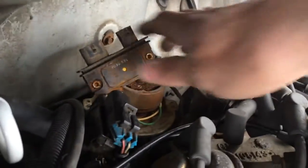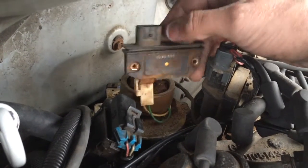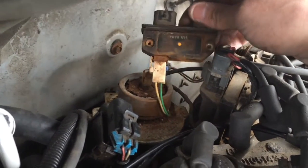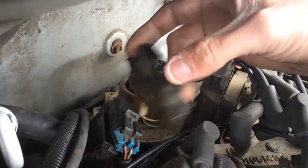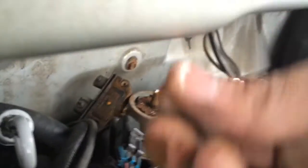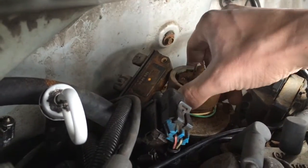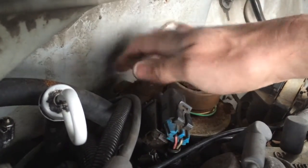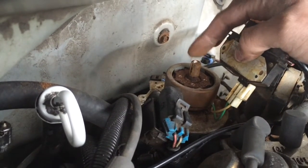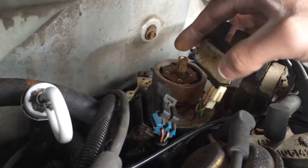There's a pigtail here, but there's a lot of corrosion in this distributor, which is starting to make me think the distributor itself is no good to me. I probably would have been better off ordering a brand new distributor for this automobile. There's a lot of rusty sediment in there. I'm going to try and clean this up as best I can and see if I can get that broken piece of my old rotor out.